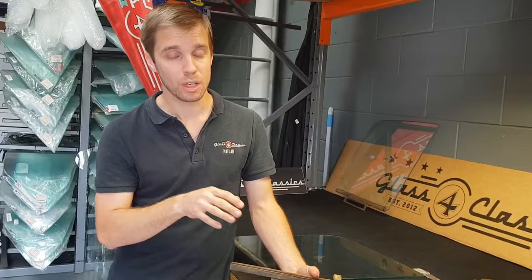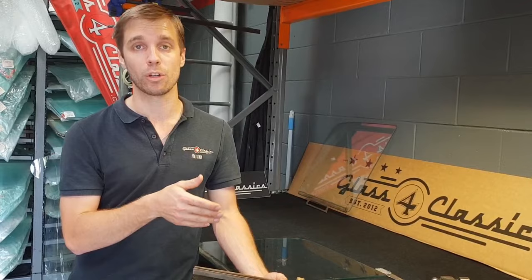Now as you can see in there, there's plenty of surface rust. This is exactly what you're going to have to wire wheel out or get in with a wire brush. We do recommend going and getting them sandblasted and powder coated — it's much more effective than getting them re-zinked or even galvanized, and it costs very little. You're going to have to get all this out. If you're not going to go to the extent of re-zinking, powder coating, or anything else, at the very least once it's wire wheeled out, get some wax and grease remover or thinners in there. Give it a good clean out, because when you go and put this back in, the setting tape is going to grip to the runner. If you don't clean it out, the setting tape will stick to all the grit and your runner's going to pop itself straight off the bottom the first time you wind the glass up and down.